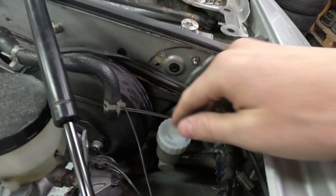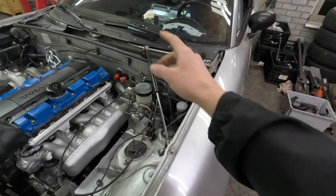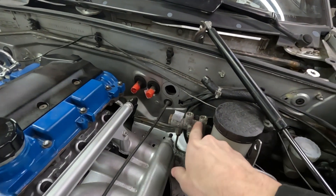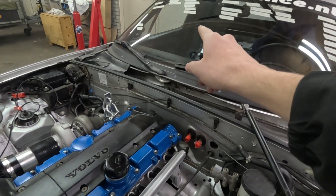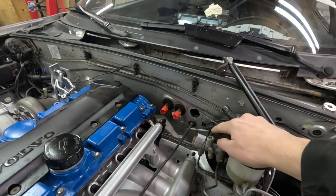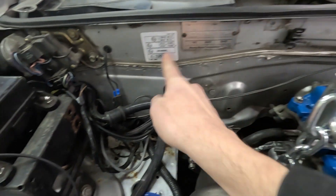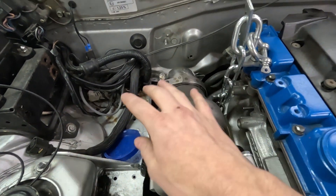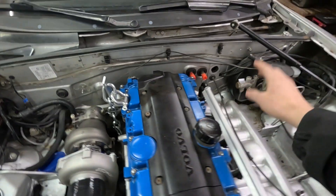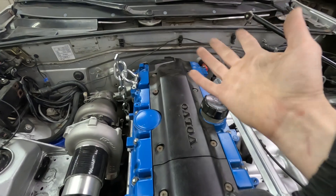In the next video we'll be making the lines going to the clutch so we can get the clutch working, but that's for a later date. I'll also likely paint the little plate but that's off camera. Next up is making the hydro work — these two lines used to go to the right front and right rear brake calipers. I need to remake these lines because on this side it got pretty tight; the lines normally go here and they go under right there, basically next to the turbo, and I don't want that. The line going to the back is going to go through the car, so why not add a hydro while I'm at it.